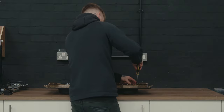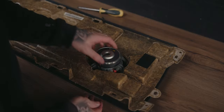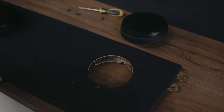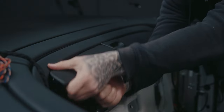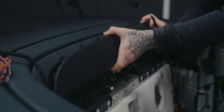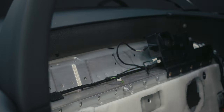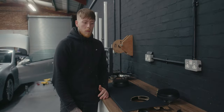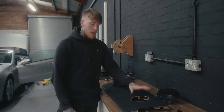We've got to think about these six-and-a-halfs mounted into quite a flimsy panel — there's no depth behind them and no real enclosure for them to perform in, so in my opinion that's not the best environment. With the two-inches, just above this panel there's another grille with two stock speakers, so the plan is to replace those with the two-inch, make new adapters, and they'll perform really well in that environment — it's almost perfect for them. All we're asking from them is a bit of fill, so I'm confident that's a good choice over these. And the other plus is we get to put this back to stock.